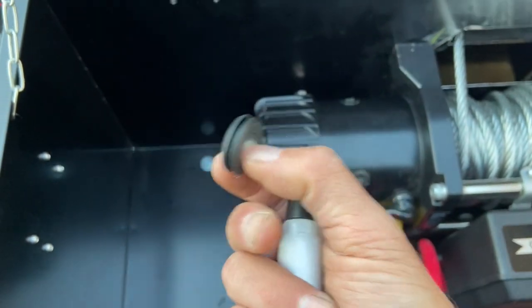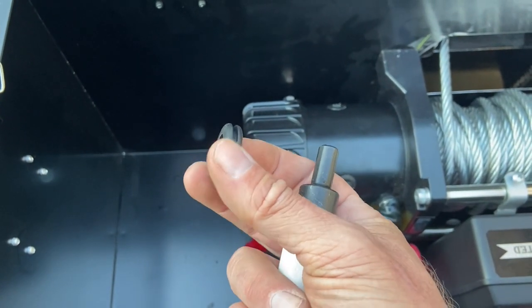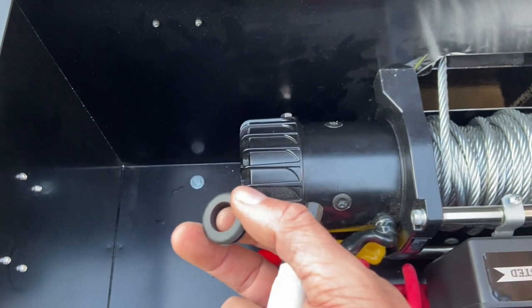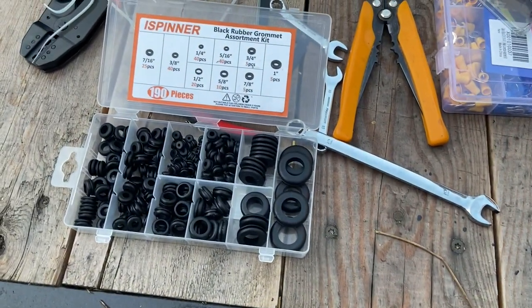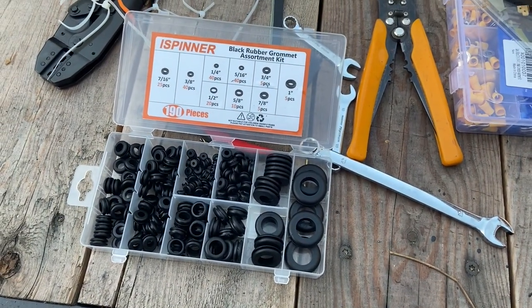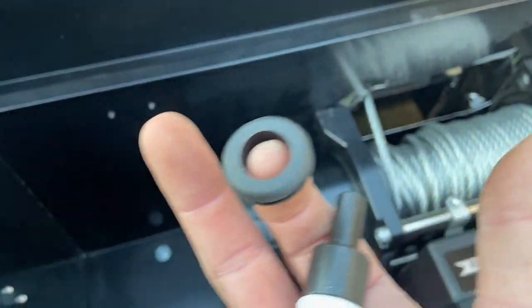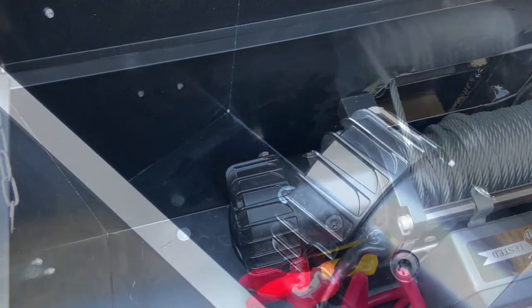These grommets are pretty much essential if you're running electrical wires through sheet metal, because it'll prevent the insulation from chafing and cutting and possibly causing a short and maybe even a fire. So grab yourself an assortment from Amazon. I'll post a link in the description. These are super handy to have. You use them all over the place. They're cost effective, cheap insurance.